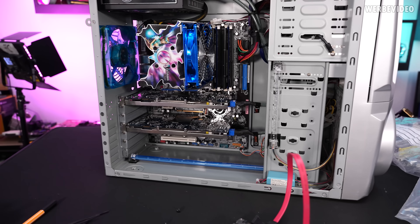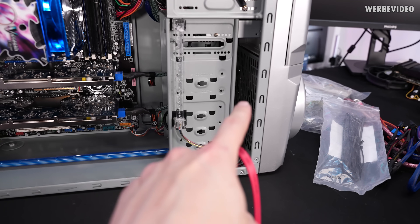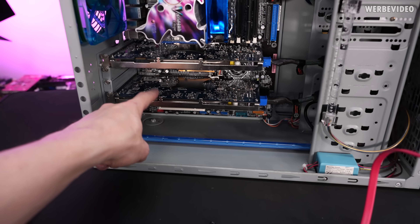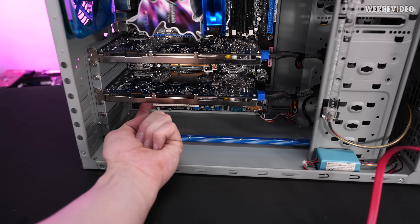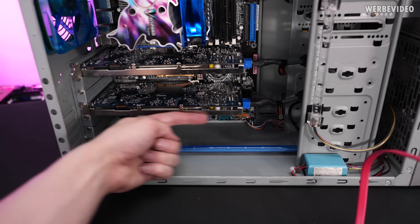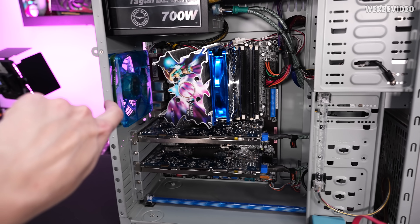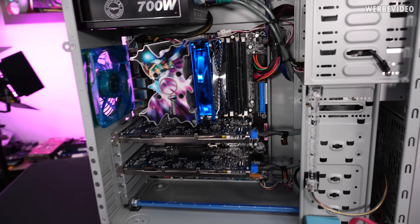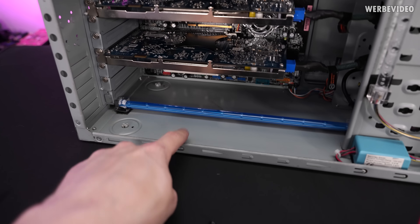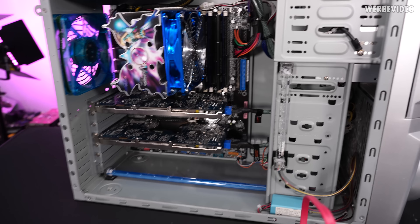This also shows what kind of bad airflow you had back in the day. The only intake is the front fan, and then we have the GPUs sitting here with the fan intake on the bottom pushing warm air in the opposite direction of the front intake fan. Then we have the CPU cooling fan above exhausting to the rear, plus the PSU fan. With no bottom intake for the GPUs, that was thermally speaking definitely not great.